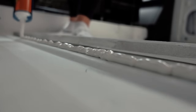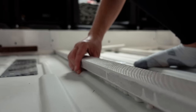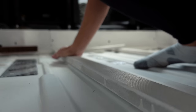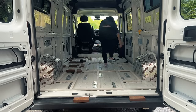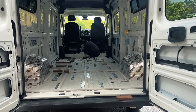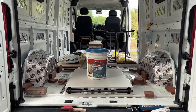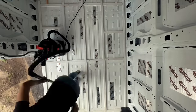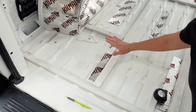After the paint dried, I glued each strip to the van floor with construction adhesive. This sticks really well. I then placed some bricks and other random heavy objects on top to make sure that they stayed in place and left it to dry all night. The construction adhesive is super strong — I cannot move these at all. They are glued forever.